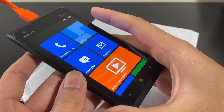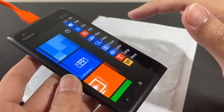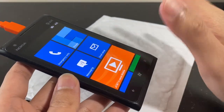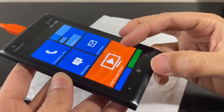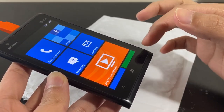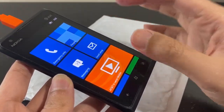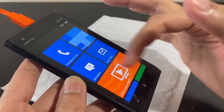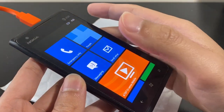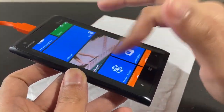I don't really need this phone, but it could just be part of my collection. I really wanted a Lumia 920 though. What I remember now is that the 920 had a bigger chin than this — the 900 has a smaller chin because the AMOLED circuitry sits behind the screen itself, whereas the 920's larger chin accommodated the extra LED lighting components for its LCD.